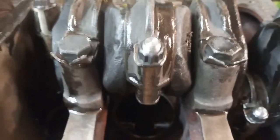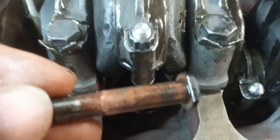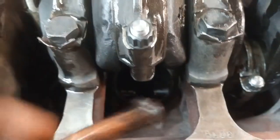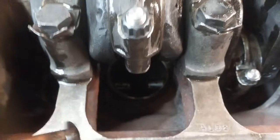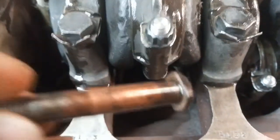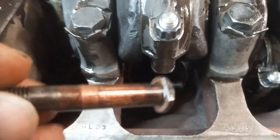One or two observations: I've put new rod bolts in here, and if you do that just check this - there's a little chamfer there, just catching the light on this old rod bolt. Some of the new ones have terrible chamfers, and that I think is quite important because it just clears where the groove isn't cleaned out properly on the rod. Without that chamfer it just might not seat properly and just might not pull through enough, so double check that.